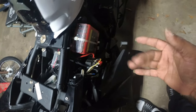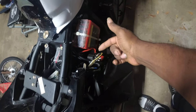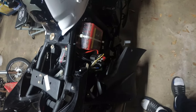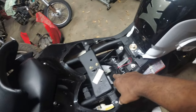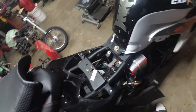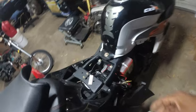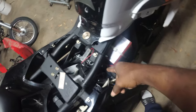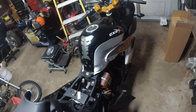Also, I had to change out the starter relay — it was just clicking. I think it had a little switch inside of it with corrosion on it. I still have to hook it to the bike; I got the rubber on it. Good thing I had a couple of those. I was also thinking it could have been the CDI but it wasn't. I do have a couple of CDIs also. I got to hook that back to the little clamp and put it back in the case. Right now I'm letting it run for a little while to charge that battery up.